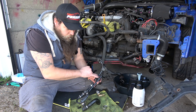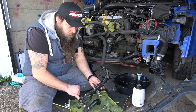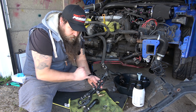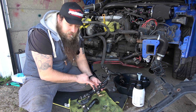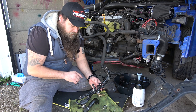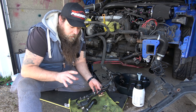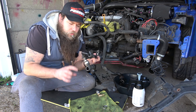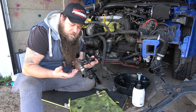I'm going to test all the one-way valves. I can do that by — once I remove the damaged rubber — blowing through it, and it will only go one way; then you know it's good. Really easy — it's got an arrow on it saying which way the flow is. This one is fine because I replaced it a while back when I had the car, because when I took the inlet manifold off for something else it was leaking. With all rubber hoses and anything to do with air and the engine, it's really easy to find a pipe that's no good — just give it a little squeeze and if it stays compressed, you know it's compromised.